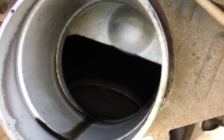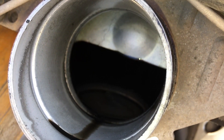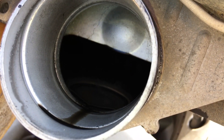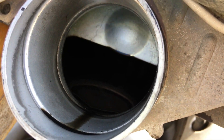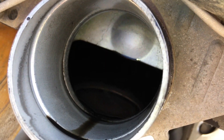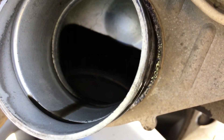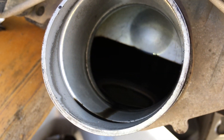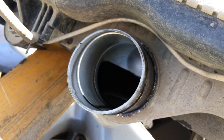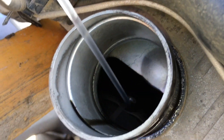Now, the concerns about the oil: there are 34 tubes that are 5 mil wide, 20 by 5 mil — that's quite large. There are massive amounts of air flowing through this intercooler. The only place the oil is, is in the bottom tube. It's not full — even if it was completely blocked, you've still got 33 of 34 tubes flowing. But it's not completely blocked. That's a whole length of 600 millimeters. So we're going to use a 10 mil syringe to extract this oil.